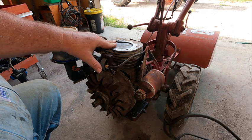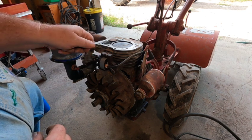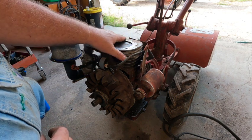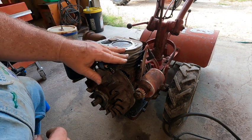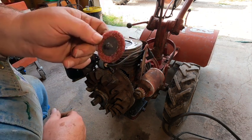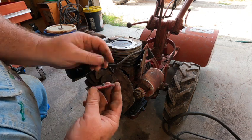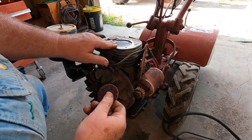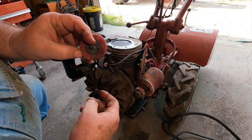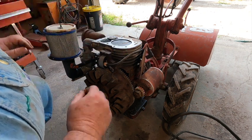I need to clean this surface before putting the head gasket on - it's not in too bad a shape. Be careful about taking a metal scraper and cutting or gouging it - you'd be creating a potential path for compression to escape. I'm going to show you a tool - it's not the right one, don't use it. You can get these little round discs in plastic. This one is kind of abrasive on one side and there's no way I'd use it on my air tool because it would take the metal surface down. The plastic version - green or blue - is the correct one. I'll clean this up with a plastic brush or plastic scraper.